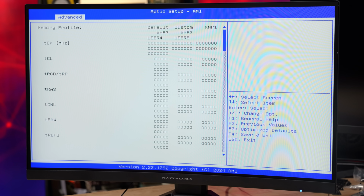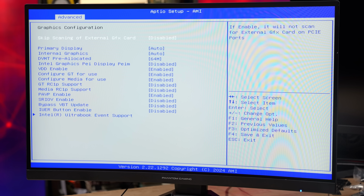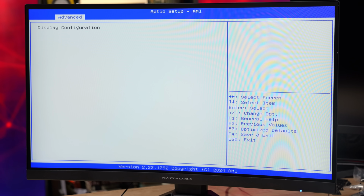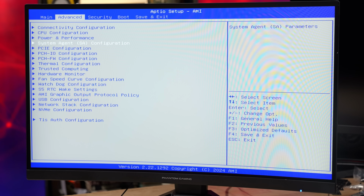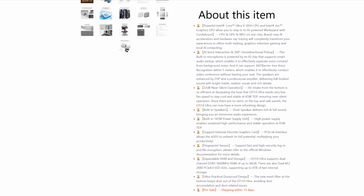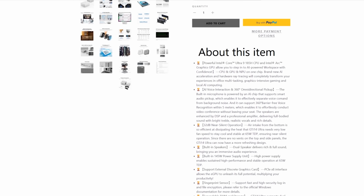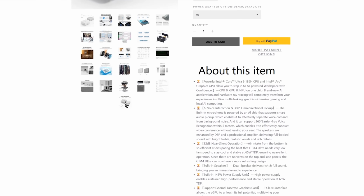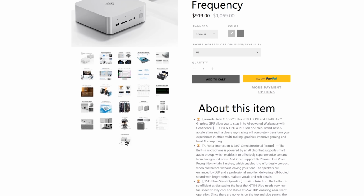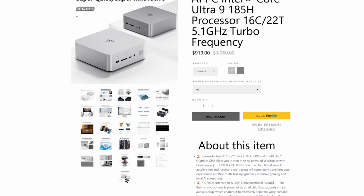That may be something that's worth spending some time in the BIOS tuning. Again, this is the out-of-the-box default. Maybe it's possible to improve the memory timing or go in and fiddle with it. JEDEC standard 5600, not really that slow, but those E cores that are on the external complex may need to be disabled. But for gaming workloads, and especially if we add an external GPU to this, that's going to be one of the things that I test in that video: can we claw back some of the memory latency? Can we disable some of the E cores and get back some of the memory latency and gaming performance? What does gaming performance look like when we fiddle with some of those settings in the BIOS, which is very nice that it's unlocked.